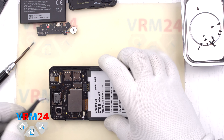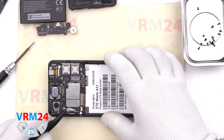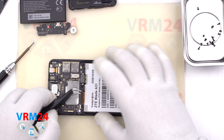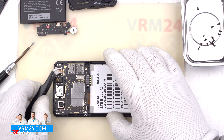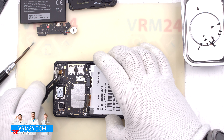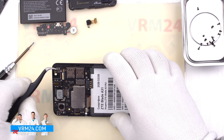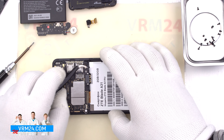We also don't need to remove the interboard cable. Now we turn to the motherboard. We check for any remaining screws — there are none — so we start disconnecting the cables. We begin with the cable for the side buttons, then move to the cable for the display, and disconnect the front camera, which is 5 megapixel resolution. It is also taped, but only slightly. We then begin to disconnect the printed circuit board, making sure to also disconnect the coaxial cable connector.